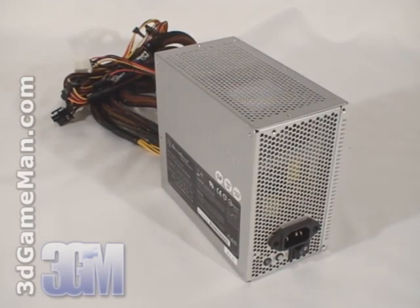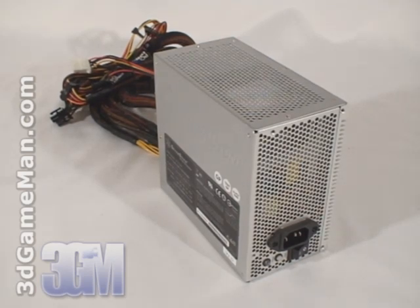There are a couple of important things to remember when selecting a power supply. The first is wattage — determine how much wattage you require based on the hardware you'll be installing. Generally speaking, a medium to high-end gaming rig would require a 500 to 700 watt power supply. If you're going hardcore with a multiple video card setup and lots of other hardware, select a power supply above 800 watts.